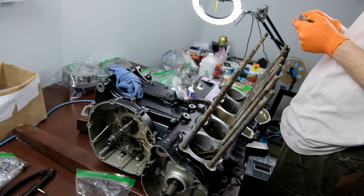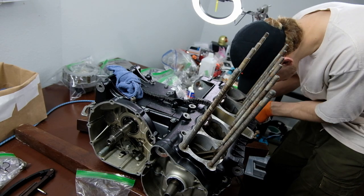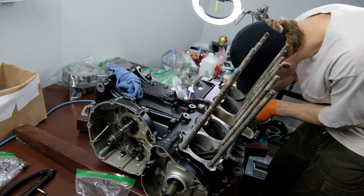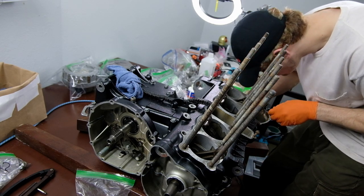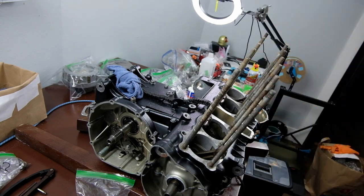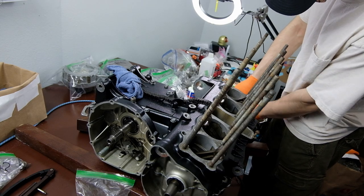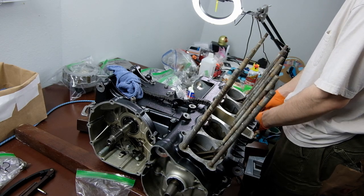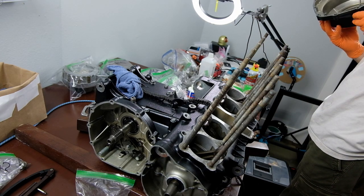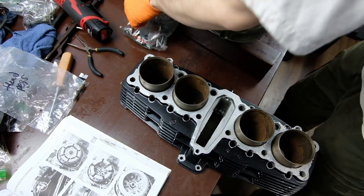It'll be hard, especially if you replace your clutch springs like I did. I actually only replaced half of my clutch springs. I did every other one. I didn't want to destroy my left hand, and some other guys had said that's not a bad idea. So I have three old ones and three new ones to not make it as crazy tight. I can always pull it off and put the other three on later if I want. Easy enough to get to.